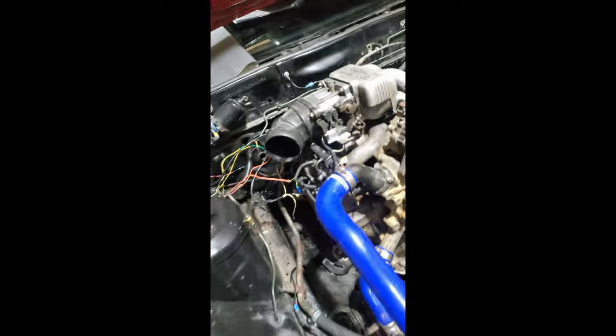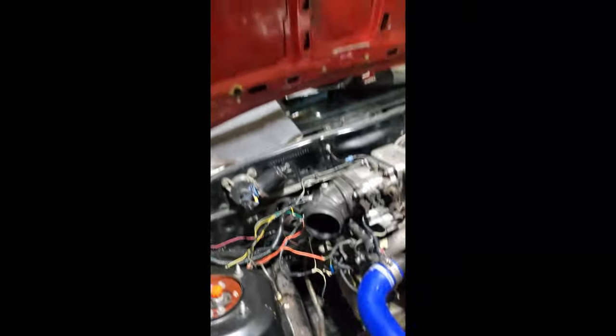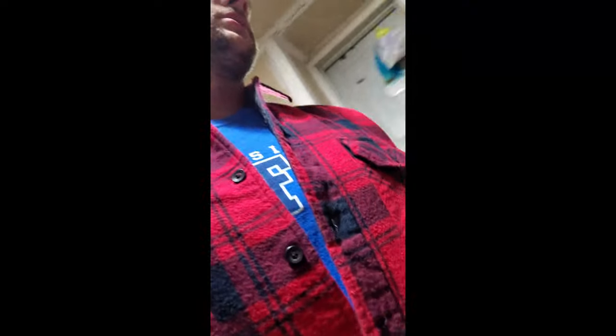I just left them twisted up — it's probably not the best way to test the car for running, but I wanted to potentially switch out where I put each injector in the future. If I wanted to put the stock injectors down below, all I'd have to do is switch up the pigtails. I don't have too much extra wire play to be snipping and cutting, so I'm playing it safe. The less connectors the better, especially in areas of heat — you accidentally pull on a wire and then you've got a break. The more wire you have there and the more you can get it out of the way, the better. Down by the ECU plug I do have all the connectors finished up with the solder connectors — they work so well. I'm so happy I bought those. I'd honestly recommend them — just got them off Amazon in a little assortment pack and they work fantastic.